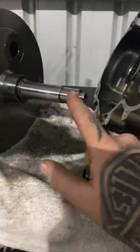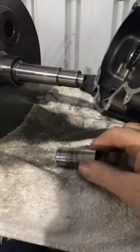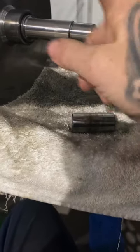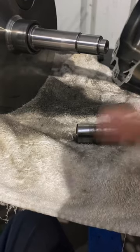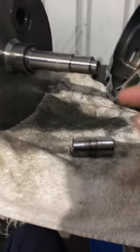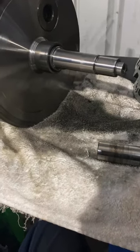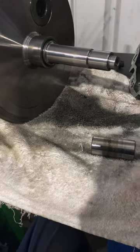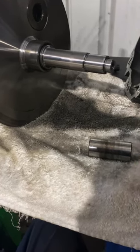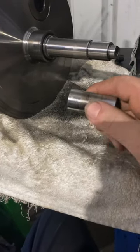With that run-out on the pinion side being in an egg shape, it's been walking itself. We've seen the oil pressure obviously shift due to the fact that the oil pump isn't rotating in harmony — it's not going round, it's going up and down, getting thrown everywhere. It bites into the oil pump housing itself, which then creates an open cavity, losing all pressure availability.